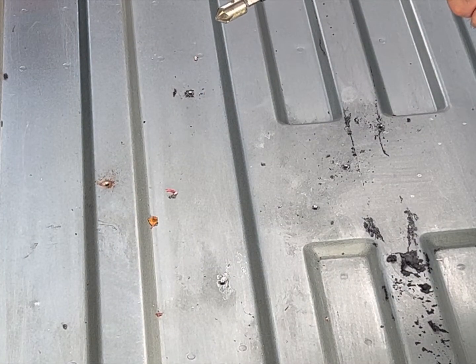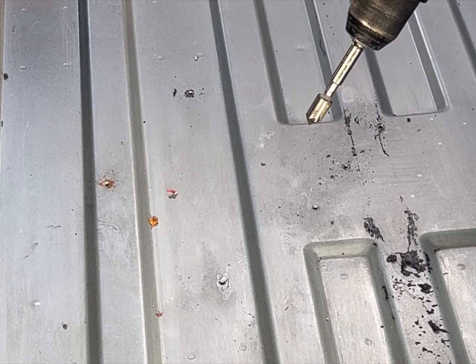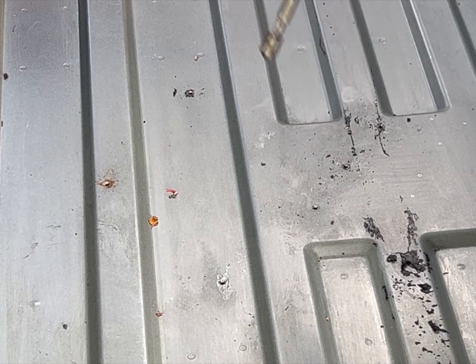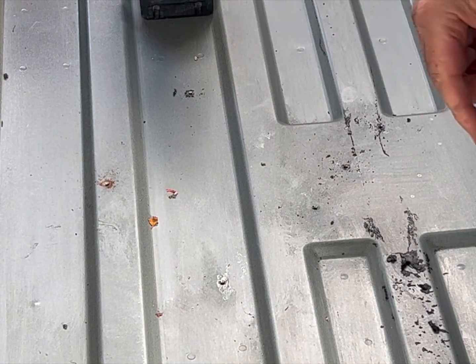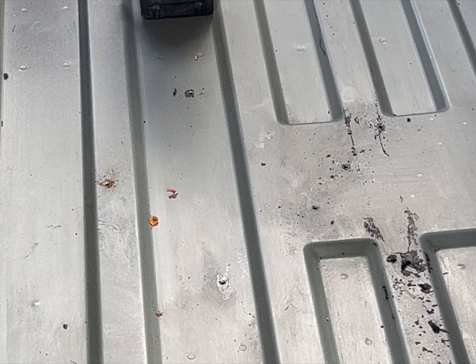I've used this little beauty, so I've drilled a hole straight through so that we clean those holes up, and then I've used just a countersink tool just to clear those up, not too far down because we don't want to make the metal chamfered and too thin, but we just want to take the burrs off because I'll be sealing them just with a pop rivet. Great little tip from Alex Froude, I believe, of Mispronounced Adventures. Fantastic little tip, but just fill those holes up and put a bit of sealant on. But let's prep them first.